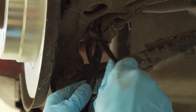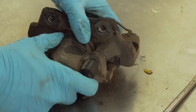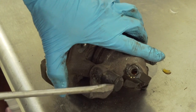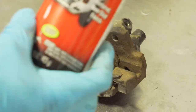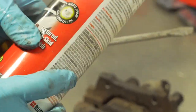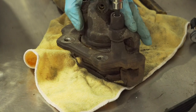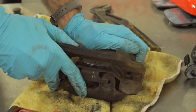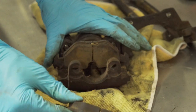Start cranking and that should free up the soft line. You might need to take out the two guide pins if your pads are pretty worn down — that involves popping out the little cap and then there's a hex in there you can take out so the caliper comes apart. I might hit it with a fresh coat of paint — I just use bed liner since the surface is already rough and I'm not planning on tracking the car. The two guide pins are a size 7 allen. Take those off, remove the clip, keep the bracket oriented how you took it off, and the pads will easily come off.